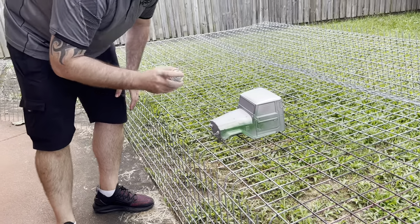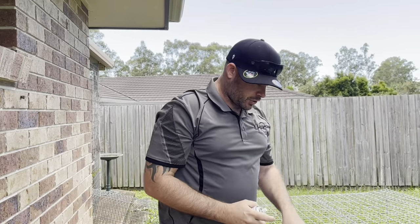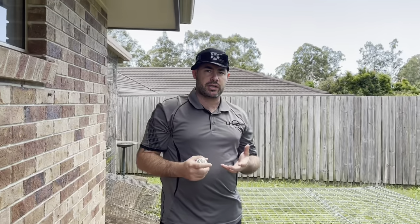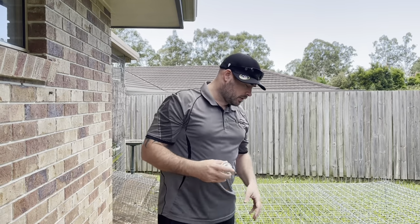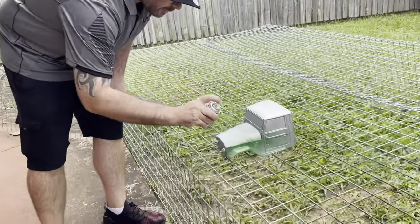What we're doing here is, because we're painting the outside now, we're not trying to get into all the creases and stuff like that, because at the end of the day, the creases are where the rust is gonna be. So if you don't get as much in there, it's gonna make the next process easier for you, but you still at least wanna give it color. So we're just gonna dust over it.